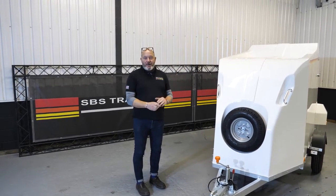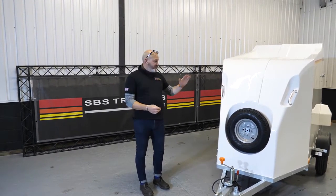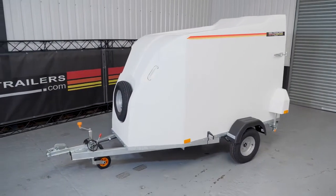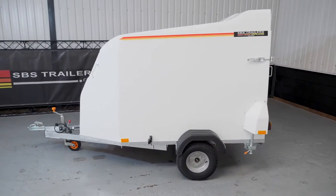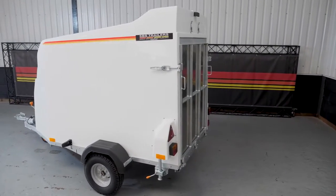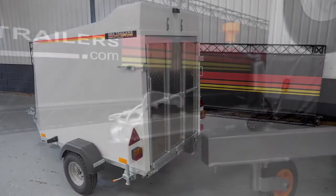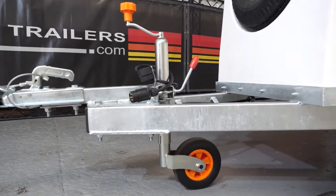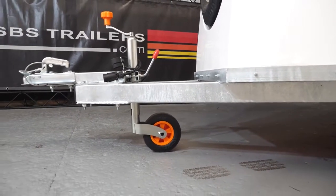It's a beautiful aero shape, so it tows really well and is very stable at speed. Again, in the SBS tradition, it's a full turnkey package — nothing you'd need to attach. It's got fabulous grab handles, a spare wheel, drop jacks, and a locking drop-down ramp at the back. This is the unbraked version, so you've got your Alco AK7 unbraked coupling head with a safety chain and a beautifully smooth cast jockey wheel.